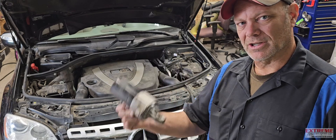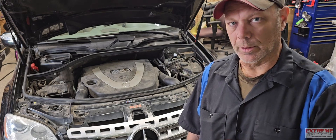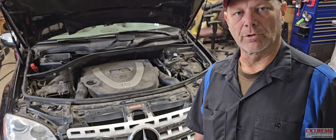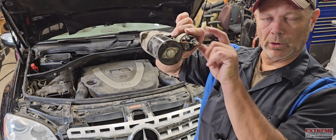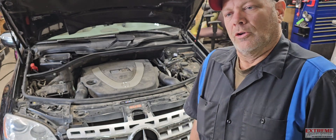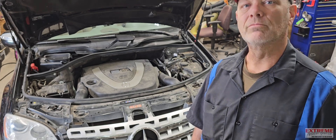I hope people actually learn something out of this process. When you're unable to get underneath the vehicle to test straight at the starter itself, looking at a wire diagram, we can see where we can actually interrupt at the fuse block itself, which made it pretty handy. Seeing that we have power there, we didn't have to go any further. The next process was to actually get underneath the car and test right at the starter, at the solenoid point, where it was getting signaled but we had no activation. Hit the like and subscribe — appreciate you guys following along, and we'll catch you on the next one.